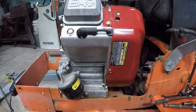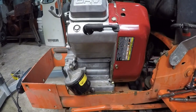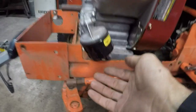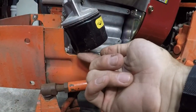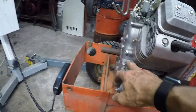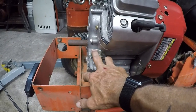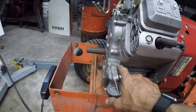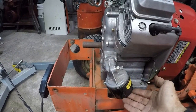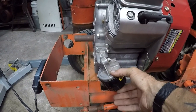So as you can see, it's not a quick, simple, easy process. It takes figuring. So with the oil filter, there's only about 1/8 of an inch gap right here. That's it. That's all you've got. So in order to change the oil, my best recommendation is, and I've got the IPL, the individual parts list for this engine, to order 3 or 4 of those gaskets, and then when you're ready to change the oil, pop those off. Just pull the whole oil filter assembly off and replace your oil filter, and then slide everything back in. Don't go getting the high capacity big oil filters for it.